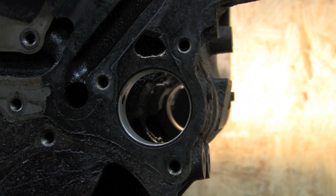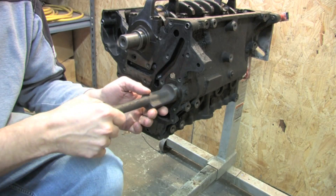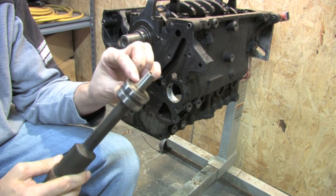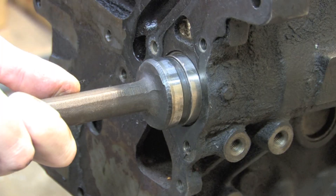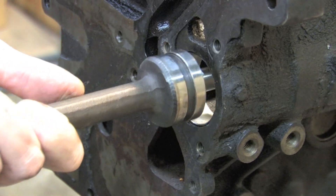To prevent causing an oil pressure problem with the shafts removed, you have to block those oil holes off. The easiest way to do this is to flip those bearings around inside the block. Not everyone has access to a bearing driver, but you can use the front shaft to drive the bearings out. The outside journal of the front shaft is turned flat with a pretty good edge on it — you just tap around the outside of the bearings to get them started then drive them out.